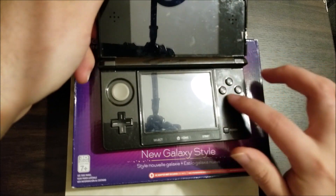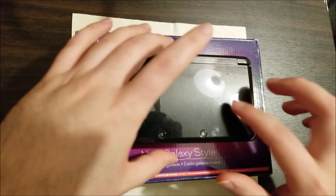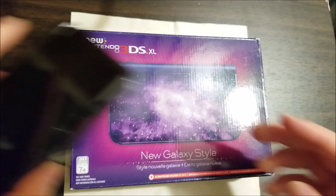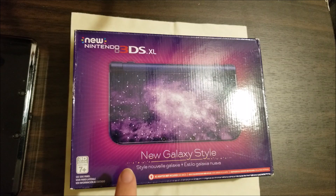This guy — the face buttons don't work for some odd reason, but everything else works. So I'm pretty sure I just need to clean off or replace or do something with the membrane pad underneath there. The second one: I tested it out and I think just about all the buttons don't work. The only buttons that work, I believe, are the face buttons and the home button, and everything else does absolutely nothing. So this might be tougher to fix.